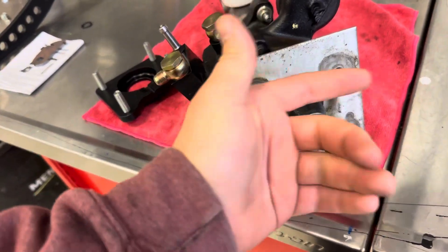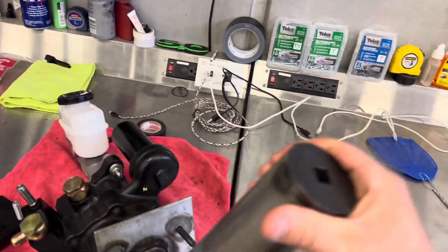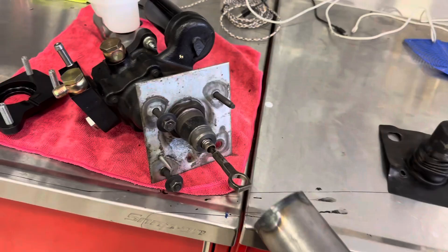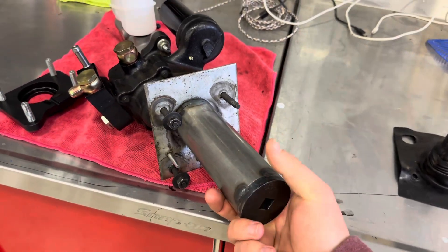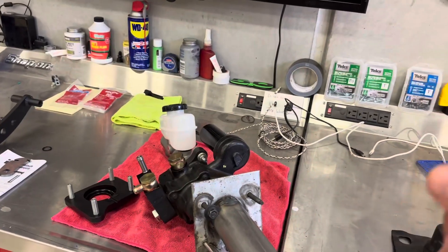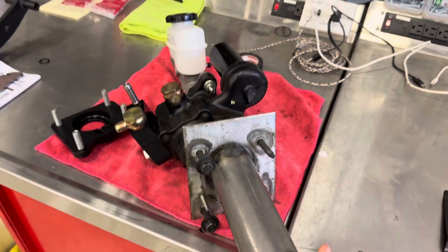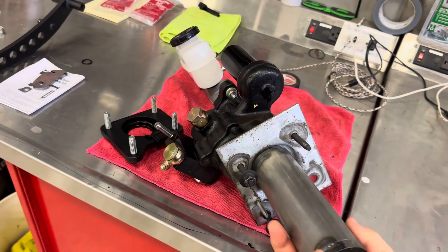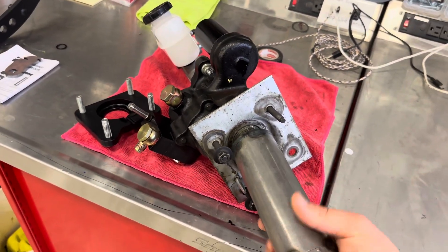In the kit it comes with this tool — you hook it up to a 3/8 ratchet. It comes with a keyed way on the bottom, and all you do is stick it over and grab your 3/8 breaker bar and break it loose. It is going to be very tight — I had to put it in the vise and pull as hard as I could. But once loosened, all you do is just turn it and it comes loose. It's just threaded on there, not reverse thread.